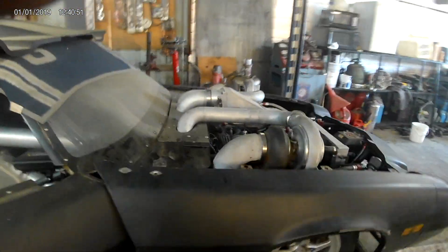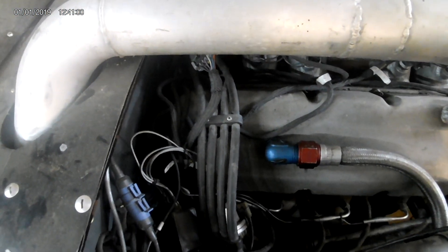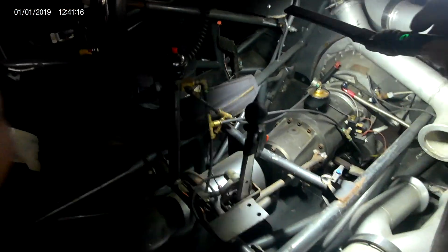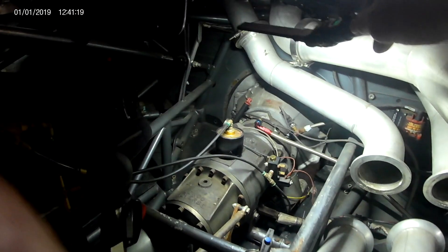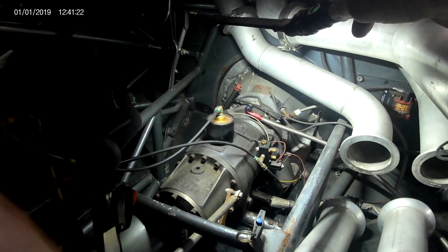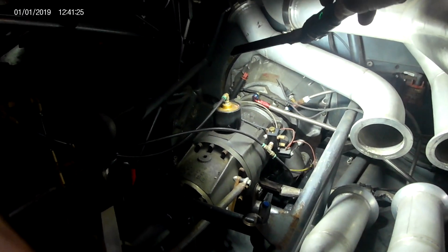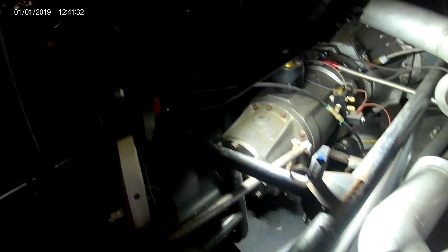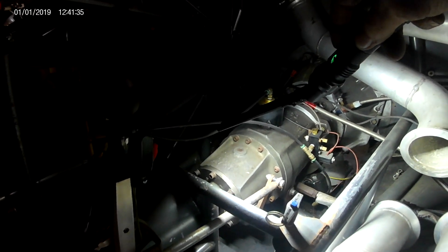I changed the return out of the bottom of the turbos to the valve covers — I thought that might work better. I ran two different lines for breathers to the puke tank. I've got a light, maybe this will work for us. That's a Bruno Lenko — real nice deal — monitoring pressure. There's a dump valve so I can change pressure on the starting line; this way it helps spool the converter faster.